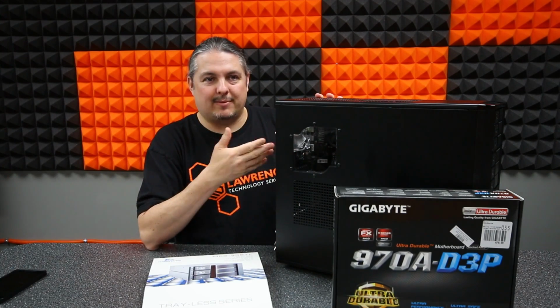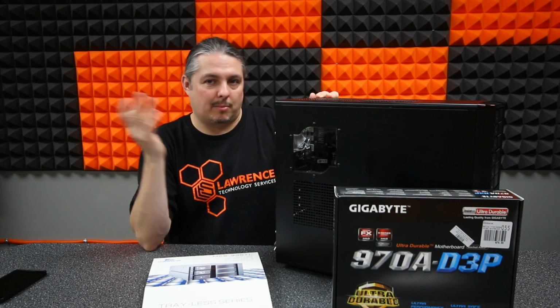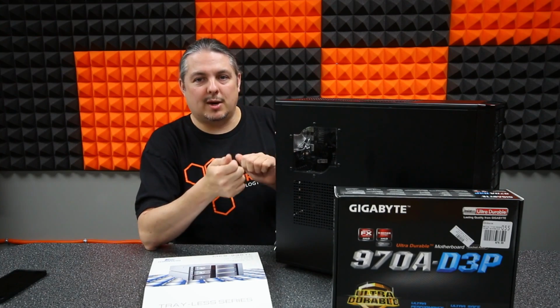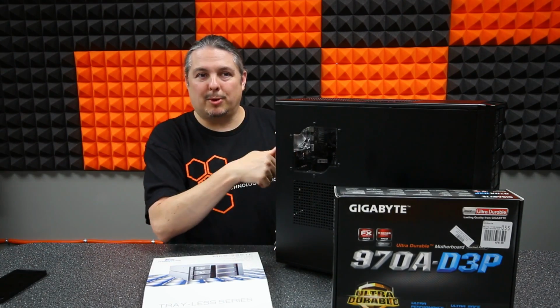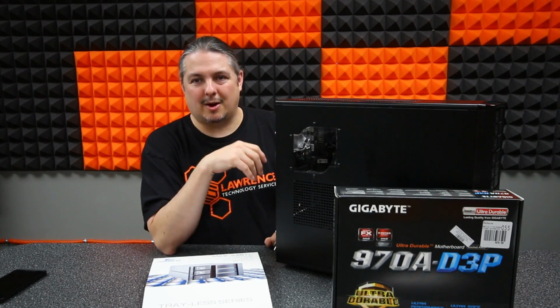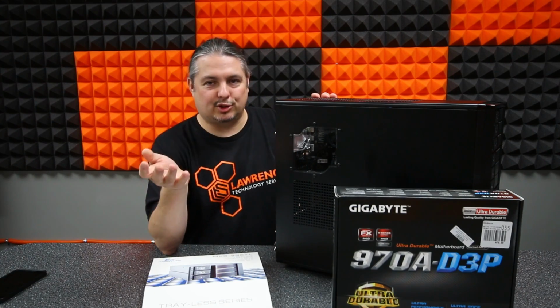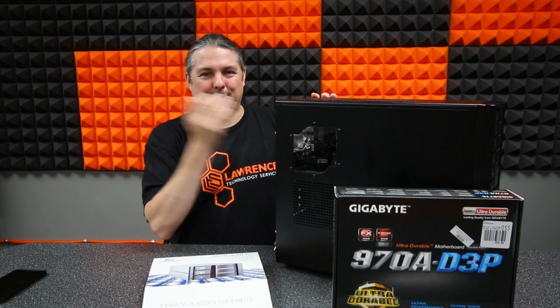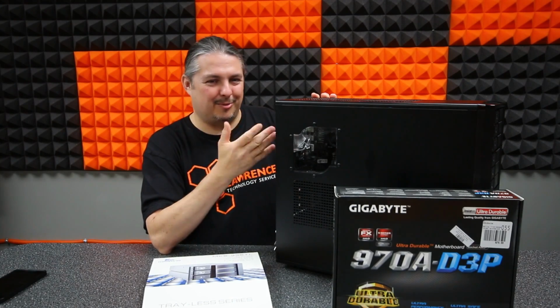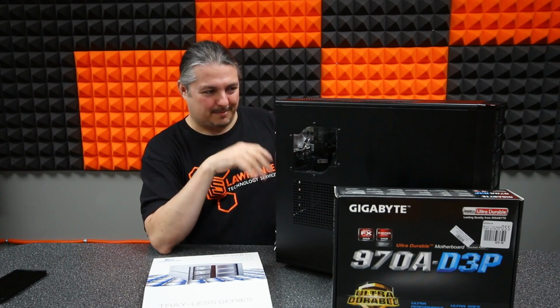But also not having to worry about the thumb drives. If one goes bad, an alert comes up. It says, hey, I can't find one of them. We've tested this. It boots with either one individually, but then it tells you that there's a resyncing issue, but then you plug them both back in and it resyncs them, and away you go. So it works really well for having that redundancy. And they're so inexpensive. I mean, these things are $10 a piece. So for $10 extra, you can have redundant, mirrored RAID 1 thumb drives in there.